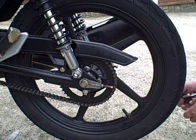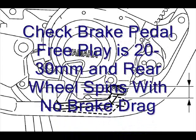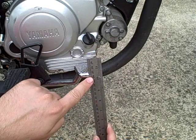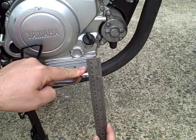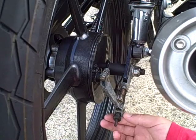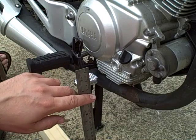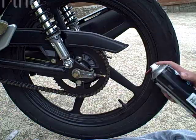The last job I need to do with tools is sorting out the rear brakes. First I'm going to re-tighten that torque arm nut and check that the cotter pin is still in place. Then I'm going to check the free play on the brake pedal, which should be 20-30mm at the pedal itself. Here I'm measuring only 15mm because tightening up the chain drew the wheel back and therefore tightened the brakes, so I need to slacken off the adjuster nut on the left counterclockwise twice. Now I have 21mm of free play, which is just fine.